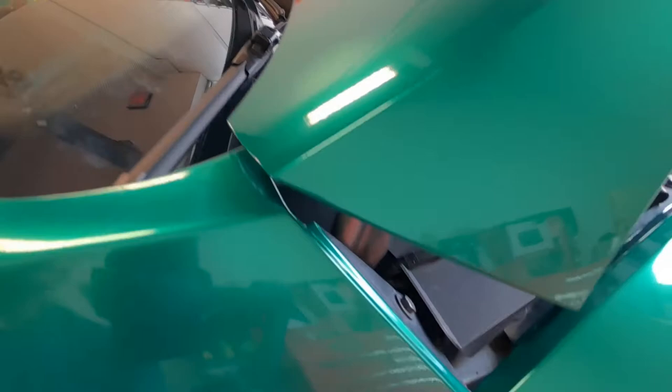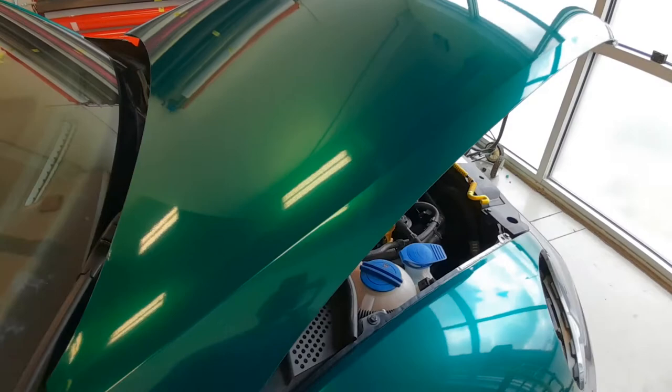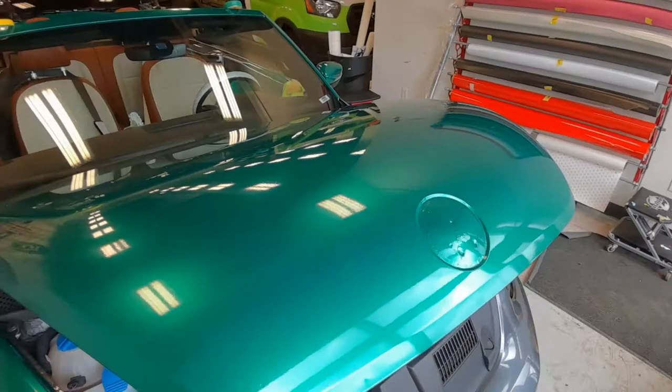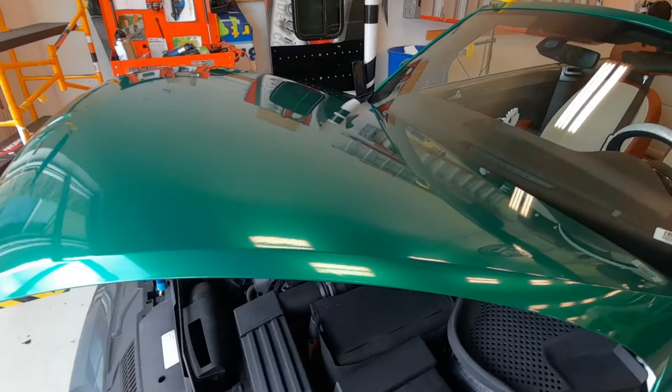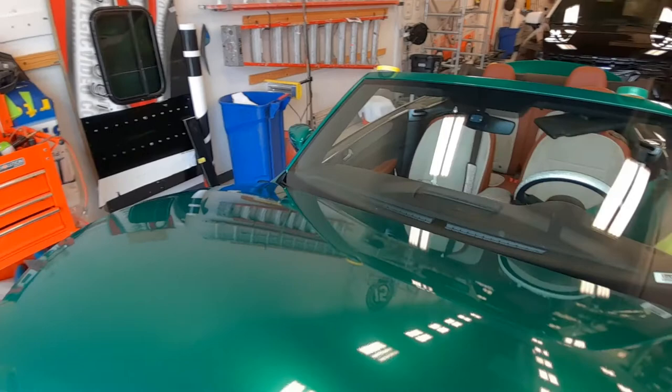You can see I've got all those corner edges nice and down, the vinyl goes over each of the edges so it looks nice and clean and looks like paint. It will also be durable because even though I did stretch it down, I used no heat to do the stretching, and then once I did go over those edges I hit it with a little bit of heat to make any shrinkage occur and also cause the vinyl to basically shrink wrap itself around the edge of the hood. So guys, that's basically how you would wrap the hood of a VW Beetle.